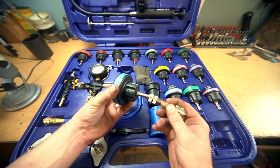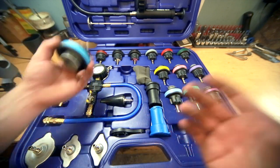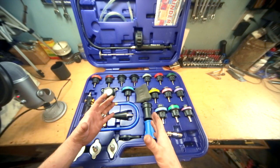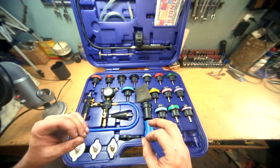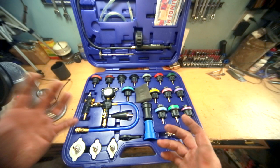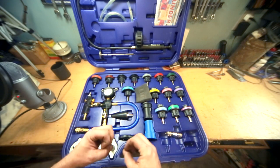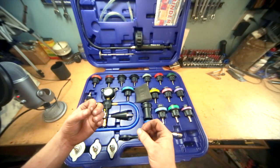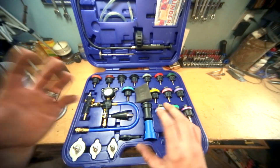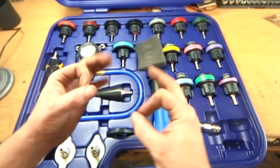The quick-connects fit together very smoothly and disconnect very smoothly — definitely like that. So what is the purpose of this kit? The purpose is for pressure testing as well as vacuuming down cooling systems in automobiles, for the purpose of checking for leaks and then filling the cooling system afterwards. The really nice thing about vacuum filling is that you don't have to go through a burping procedure afterwards. When the system has been drained and you apply a vacuum, you remove any air from the system, then fill it via the same device — no air in the system. It's a very quick way of doing a repair efficiently, and that's how we make money as technicians.